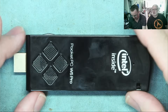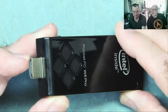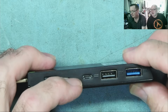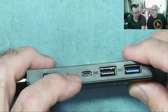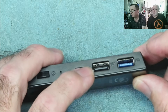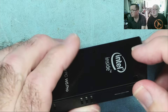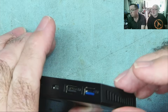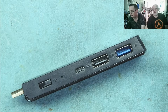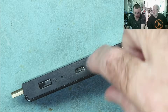If you were thinking how do I connect this to anything, it's pretty easy because you see the big HDMI connector. This is what you plug into your monitor, TV, or whatever you're using. On the side there's a power switch, a little micro USB — the thing that nobody uses anymore — for power, which is actually 5 volts at 2 amps. Then you've got a normal USB 2 and a USB 3. On the other side there's a micro SD card slot. You could put a hub in here for keyboard and mouse, or use a wireless keyboard and mouse and still have a USB spare. Wi-Fi is built in — there's no network connection anywhere else, so Wi-Fi is the way to go.